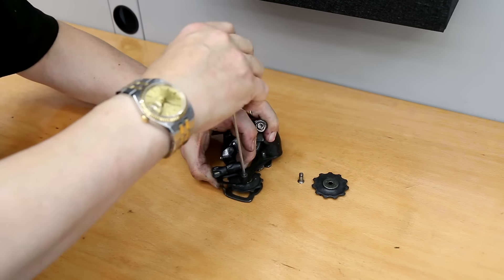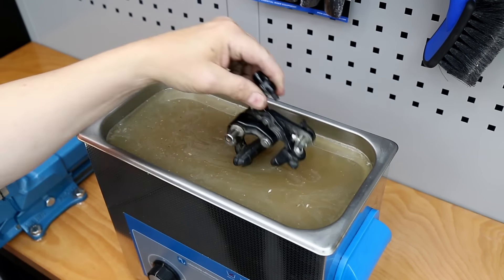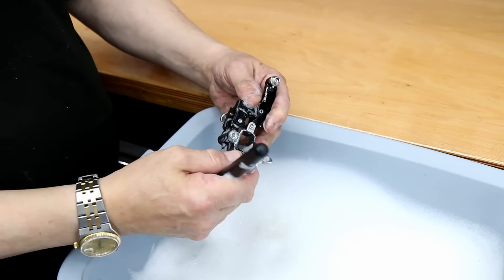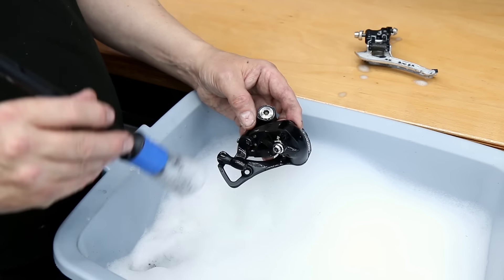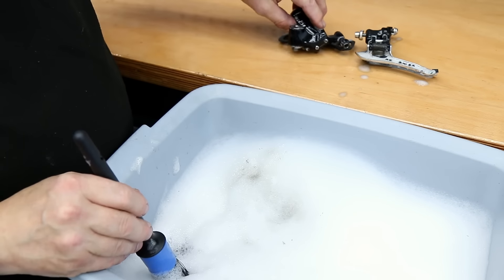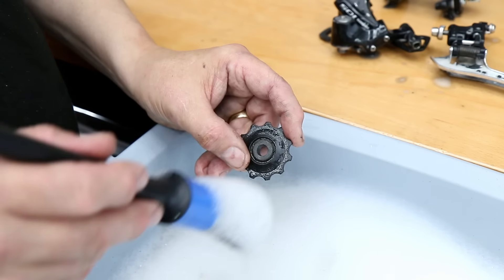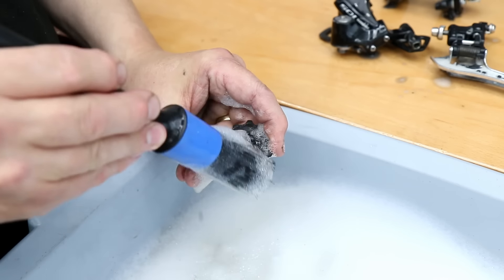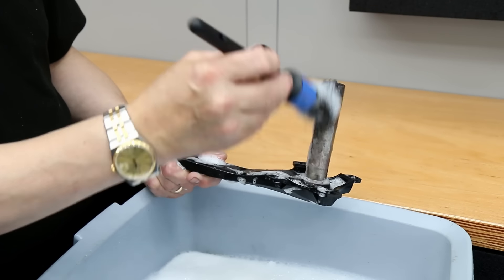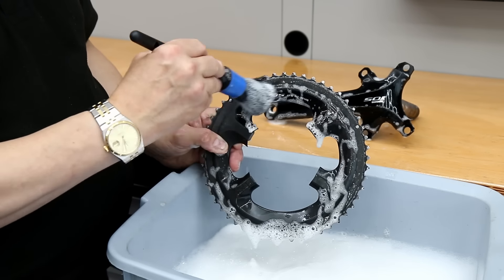Next up we're going to take the derailleur apart. We like to separate everything out before we clean in depth — in goes the cassette, derailleurs, brakes, jockey wheels. They go through the ultrasonic cleaner for about 15 minutes; we don't use any heat so we don't damage the parts. Then we wash off the degreaser so it doesn't continue to work beyond what we want. We blow them out with an airline to make sure they're completely dry before we re-lubricate them. We then wash down those components using one of our detailing brushes.